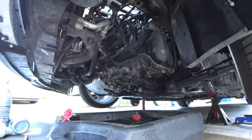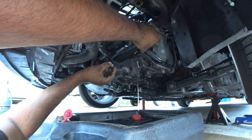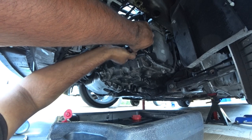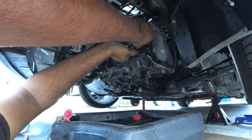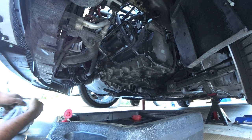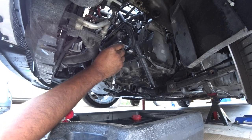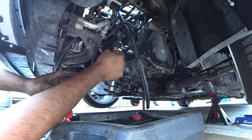Now we're going to go back down below and you'll see it's starting to spill, so get your drain plug ready because it's going to make a mess once you pull the hose out. Get yourself situated so you don't have a big mess. Once you get the plug in nice and tight — same procedure as the other side, just give it a nice good tug — and you're good.